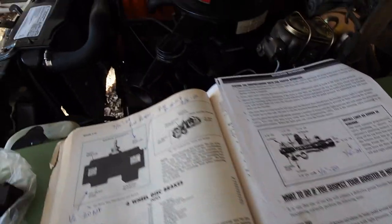I'm not sure if Camaros or Chevelles are the same as the Nova, but if you're doing a Nova from four-wheel manual drum to front power disc, you're going to need these adapters to make the connections properly. You don't need to bend any tubing or buy any tubing if your existing tubing is good. Thanks for watching guys — like, share, and subscribe. We'll catch you in Part 2 when we install all the new parts in the front: the rotors, hubs, spindles, bearing seals, etc. Thanks again for watching — talk to you later, bye.